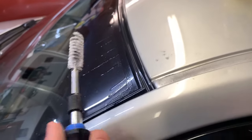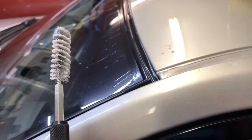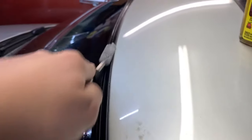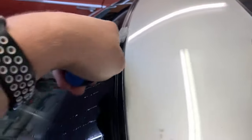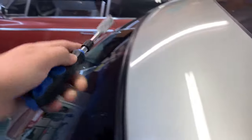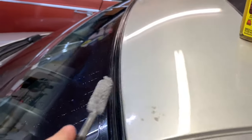I'm also going to use a hard bristle brush — it's made of plastic, not wire — and just rub along the weather stripping to try to loosen it up a little. This shouldn't hurt your glass, though it might scratch it very slightly. It can harm your paint, so be careful not to get it on anything you don't want scratched. This method isn't really required — I didn't use it on the window weather stripping — but I thought it might help a little.